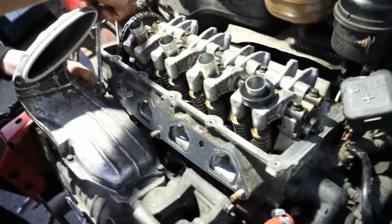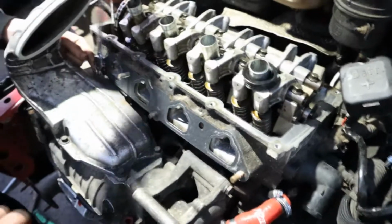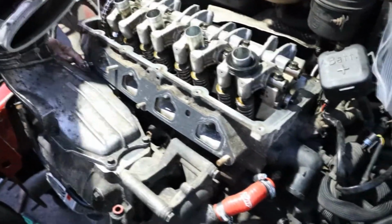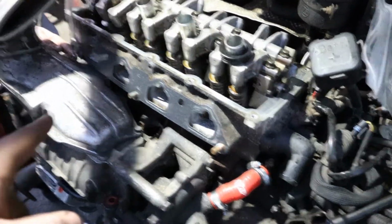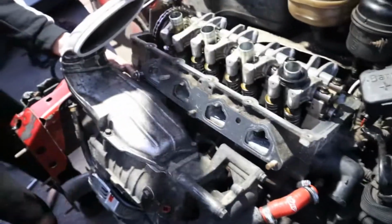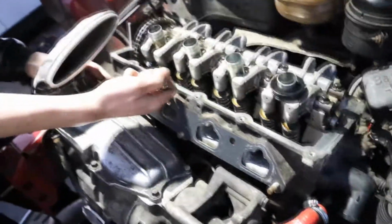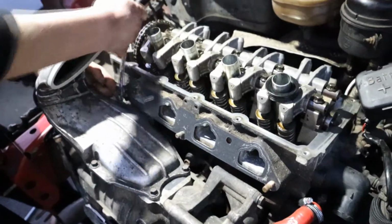We had to basically get the old nut off the stud so that we could put the intake manifold back on properly, because there's not a lot of room for it. So what we actually did was put the stud into an old Mini engine block and wound it out with 2 nuts. So now we've got the stud properly in the head, so we'll be able to bolt the intake manifold back on. So the whole point of winding the stud out, all that rigmarole, was so that we wouldn't have to take the supercharger off to put the intake manifold back on.